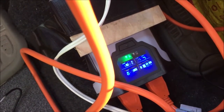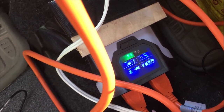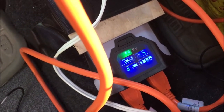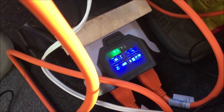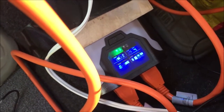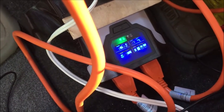Two laptops on just the cigarette lighter adapter is not going to work — you're going to set off the alarm. You can only run one laptop and charge your phone either off the USB port on the machine or through the charging port it provides, which puts out about 2-something amps. The main 120-volt line gives you 4.4 amps usable.